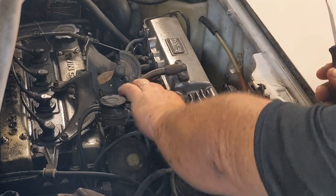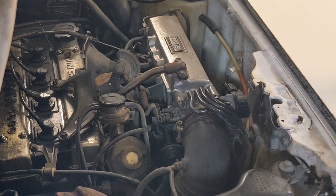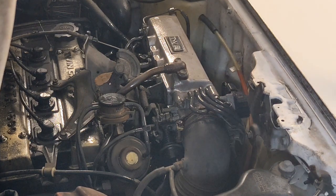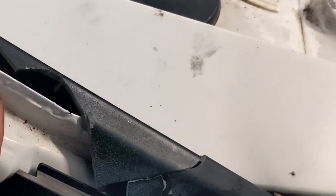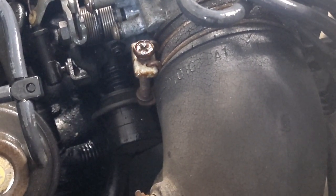I'm going to take this screwdriver and try to adjust that screw — that's about half a turn. I'll spray this stuff around some of these vacuum ports and see if there's a leak. I don't think it's a vacuum leak either. It's still idling at over 1100, so we're going to have to go on to further diagnostics. Also, I know exactly why these things break — your elbows will hit this and I just shattered another couple of pieces, so it's beyond repair at this point. I couldn't find any vacuum leaks with the spray. That stuff burns and stinks, man. Smells like hair burning.